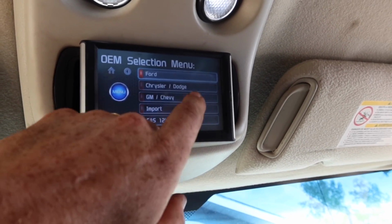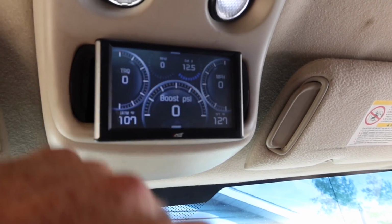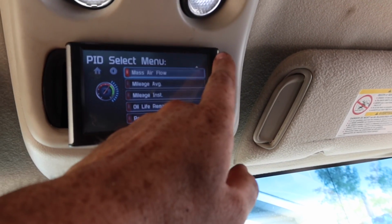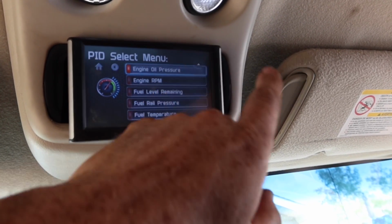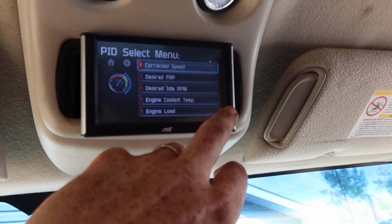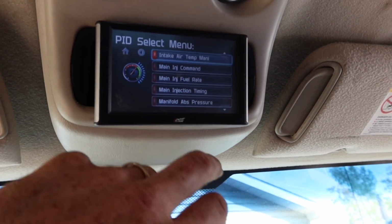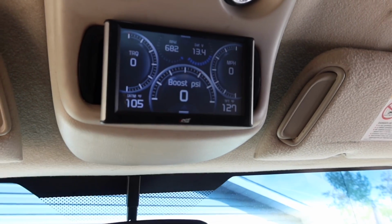Let's go ahead and see if we can pull up this EGT probe. Right, it's not showing right now, but pretty much all you got to do is I need the Edge CTS3. It's a brand new monitor, so this is just temporary for now, guys. Well, that's strange. It's not showing EGT whatsoever, so that's not good. It's not picking it up. It's probably a connection. I just need to check it. It should pick up the actual connection, and it's not.